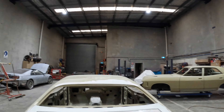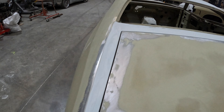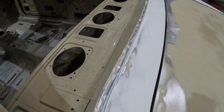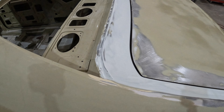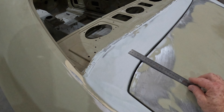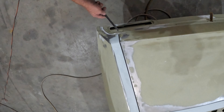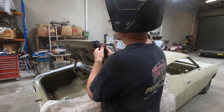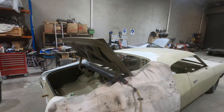Rather than film endless hours of sanding and body filler, I thought I'd cut to the chase. I've basically done what I needed to do, which was nicely cover up all of the fabrication work. I added that 25mm strip in there and ended up with a bit of welding distortion, etc. — so that's all blended in. If I put a ruler on here, roughly, it's looking not bad. I have already ground the corners, so I'm going to have to weld them.